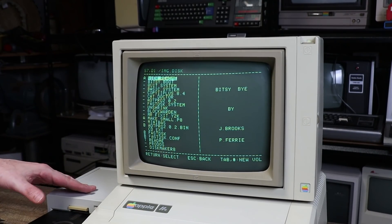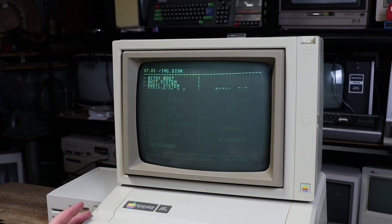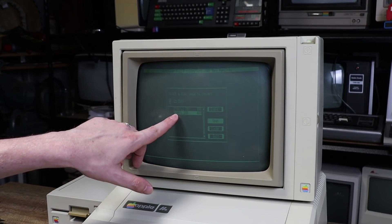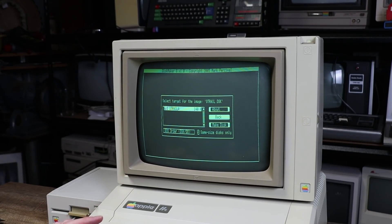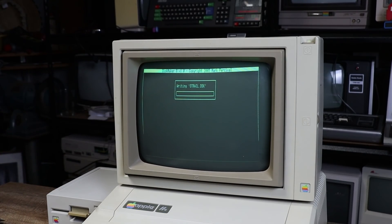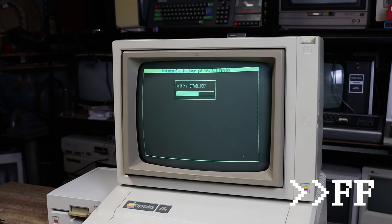Now take our disk. We're going to go down to Disk Maker and launch it. This is where we want to select our disk image — so we go down to the Disks directory we created and hit enter. We'll start with O-Trail, because that's side A, and hit enter. It will now go looking for a disk drive. And we hit tab, go down to Make Disk and hit enter. It'll ask if you want to erase — yes, tab enter. And it will write that image to the actual disk. And we're good.